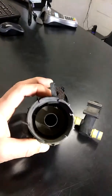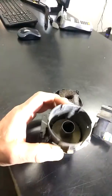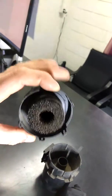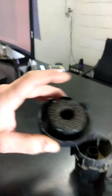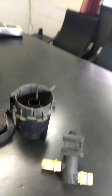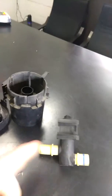Not only that, while it's under your truck, depending on what area of the world you live in and what environment you drive in, you've got to be going through a vent valve every couple of years. Maybe if this thing had a serviceable filter — a better filter system, more like an air filter than just this, because this is basically just to catch large particles. You can see all that dirt and dust inside there is what really takes these out, and that's if they're not sealing. It could also just be that the solenoid is bad inside.